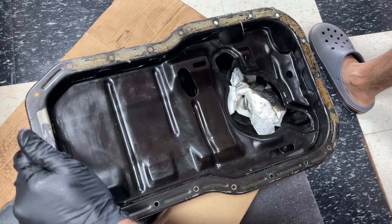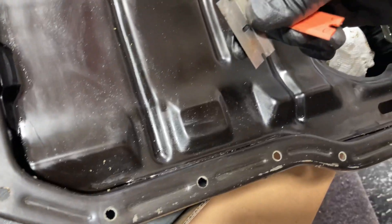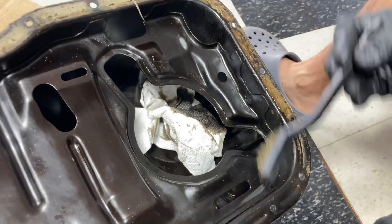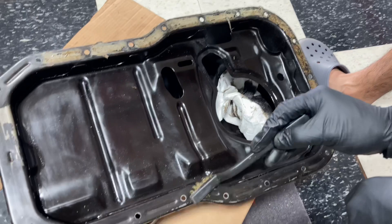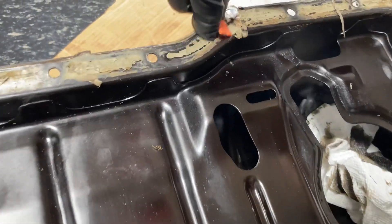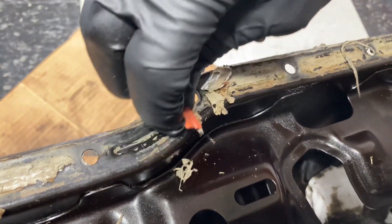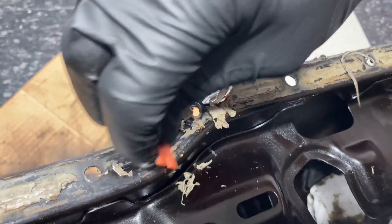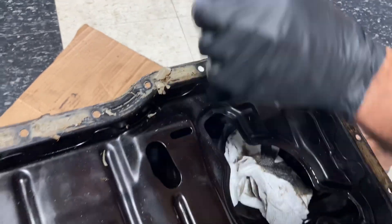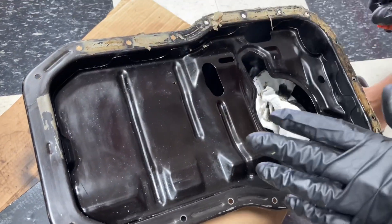The oil pan is off and we've got to clean up all the surfaces. This area is clean so far. I'm using a sharp blade being very careful, a plastic blade, and then a wire brush to clean up the surface once I get the blade through. I'm just gonna work all the way around and get this thing nice and clean - you've got to get in all these channels and clean everything out. Once we get this cleaned we'll put the new sealant and bolt everything back up. Be careful about stuff falling in - I'm gonna wash this out anyway, but make sure it's nice and clean before putting the sealant around.